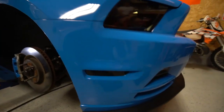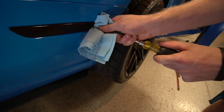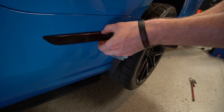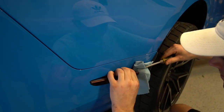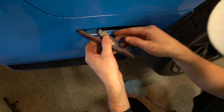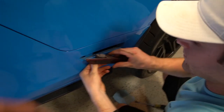We have the front installed on both sides. From just glancing at it you probably won't be able to tell the difference, but there's definitely a difference. As soon as we're done installing the rears, we're going to give you guys a little test on them. We're going to go ahead and pry this — just be very gentle when you do it and it'll pop right out. You might end up cracking these by doing this; it's not a big deal because you do have replacements, and it's kind of known for them to do that. Mine cracked in half. Just take your time. Pretty self-explanatory — once you remove it, you just plug that harness into the new LED one and it'll snap right back in. After this clip, you'll see the after results.